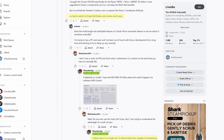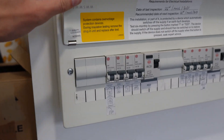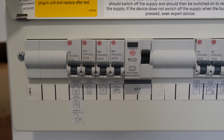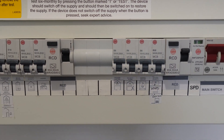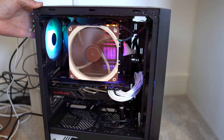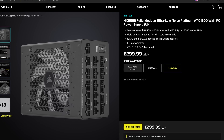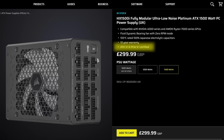This means that the internal 12 volt wires should in theory get less hot in a multi-rail PSU, because there's actually less current flowing through each of them. Also, remember the breaker unit in a home — well, this has a rail-by-rail circuit breaker, meaning that if there's an electrical issue, only one part of the system actually needs to be disabled. This can help protect our PC builds, because the two separate 12 volt rails in a multi-rail PSU will have separate short circuit and overcurrent protections built into them. But what's not so great is the price — even a lower power 850 watt multi-rail PSU from Be Quiet is a fair bit more expensive than other single rail 850 watt PSUs, and Corsair's multi-rail 1500 watt PSU costs a whopping £300, although admittedly it also supports the latest ATX 3.1 and PCI Express 5.1 standards, so you're not just getting multi-rail support for that money.